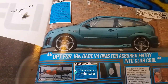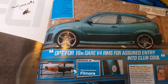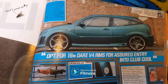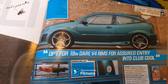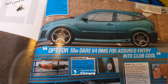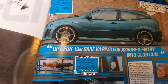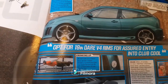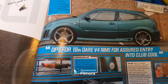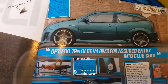Interior: full leather retrim, Momo Millennium steering wheel, Momo gear knob, full fusion polished roll cage, white dials and Ford Racing gauges. ICE-wise it's got a custom boot install trimmed in leather, polished Wizards of NOS nitrous bottle, Alpine V12 amp, two Alpine 12 inch subs, JBL P93 6x9s in the shelf and front doors, and a Pioneer CD head unit. Max power output: 120 brake horsepower plus a 50 BHP nitrous shot, max speed of 120 mph, and 0-60 in 9 seconds.